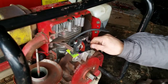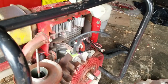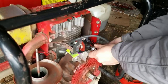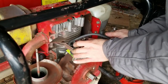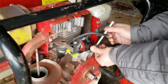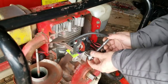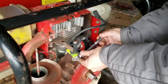Henry, you shouldn't use the impact to put those on. You'll break the posts. Yes, that's what people tell me, but I always do it anyway. Henry, you should use a socket. So it's a 1/4 inch socket on my 1/4 inch drive. And yes, you can probably remove these with an impact if you wanted to save time, but to put them on, and I used to always put them on with an impact, that's just too hard. I have stripped them before or busted the post. Oh, I thought I busted a post, but yeah. So don't over tighten them. Just needs to sit on here.